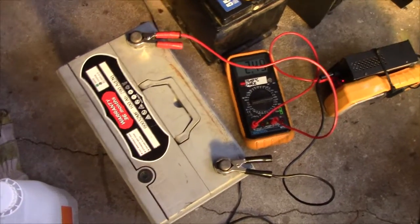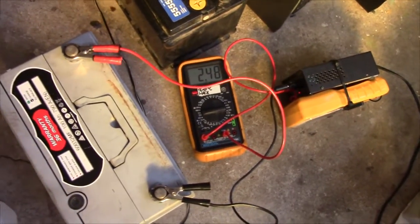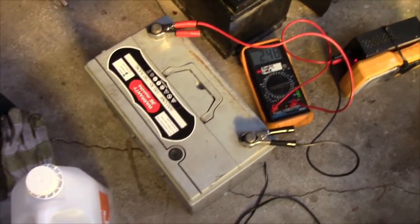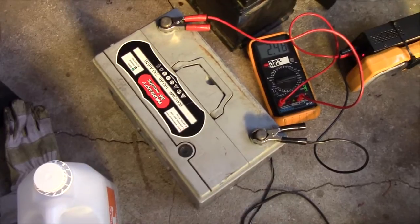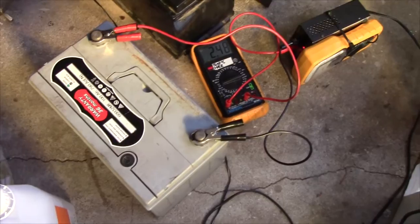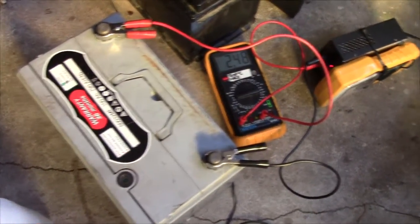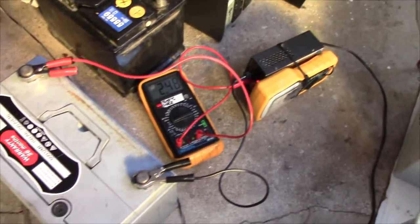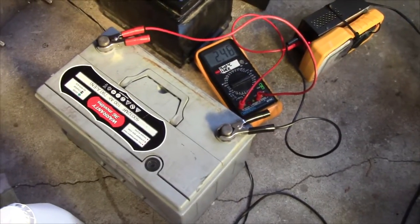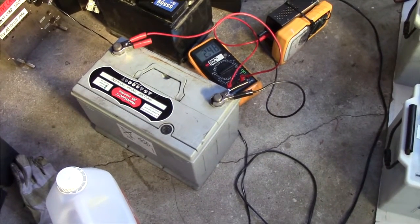And as for the little 100 amp hour guy, doing okay. It was pretty fully charged. Even when I picked it up, it had an OCV of maybe 12.6 or 12.62 or something around there. So, it's been charging too for a bit as long, even a little longer perhaps, and it's used up all the 7 or so amps this charger can give for a while, and it's been dropping steadily. So, I'll probably end up cycling this one first and seeing what it's got.